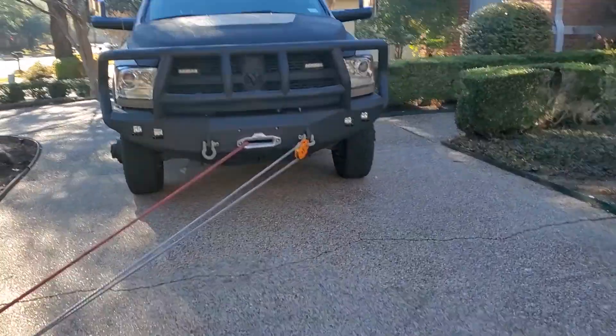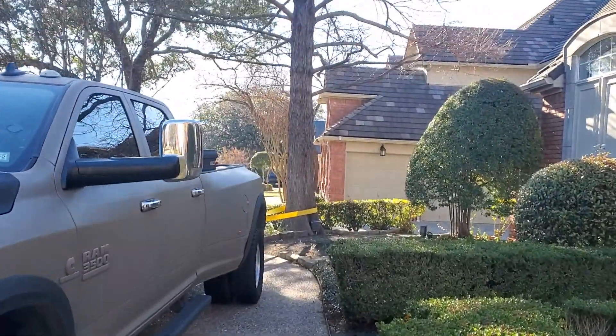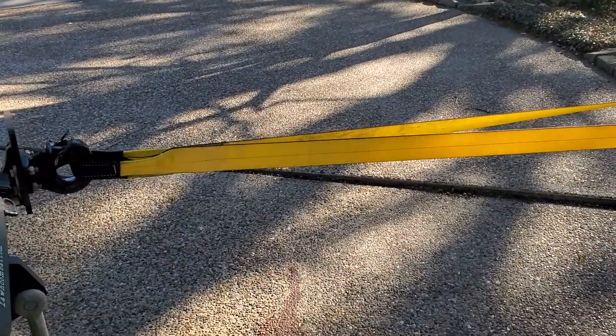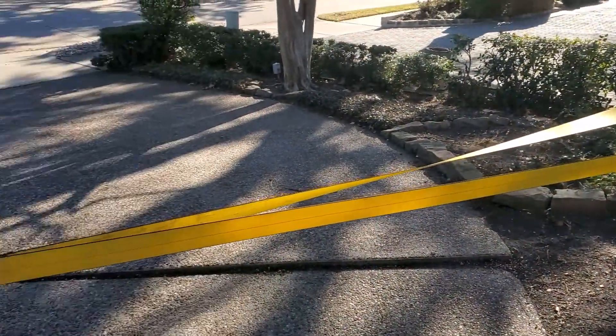Because I don't want pressure on my transmission, I'm using a big bald cypress as my anchor point. My truck is in neutral with the emergency brake on. I had to back my truck up while it was connected to try to get more slack on this strap, and I saw the stump is already moving, so I think I'm set up for success.